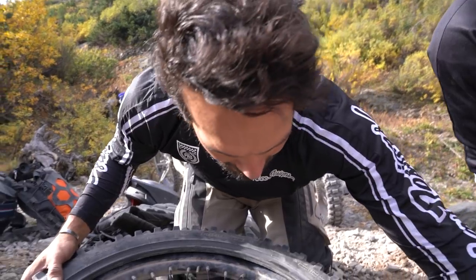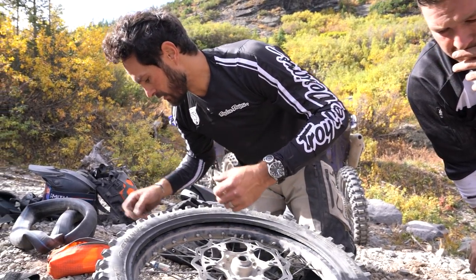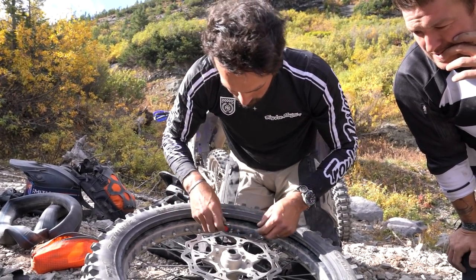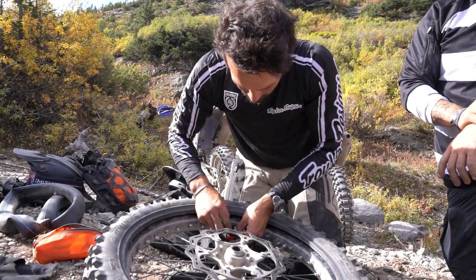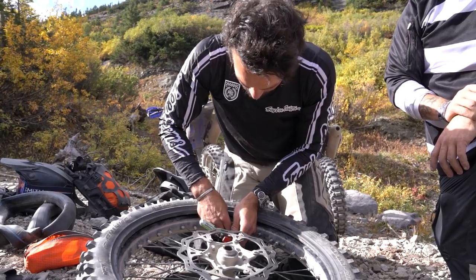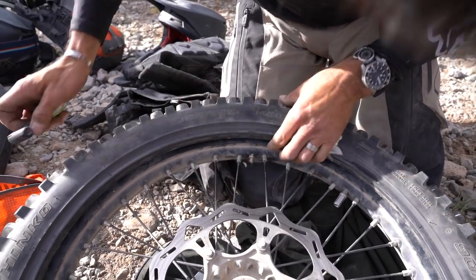So you've got the tube inside the rim and the tire is not seated. You want to put a little bit of air in it so it inflates the tube and pushes it against the tire instead of seating it against the wheel. That way you don't get a pinch flat when you're trying to reseat the tire, which is extremely common. So you take the little nut and screw it on the valve so you can apply a little bit of pressure and give it a crack of air.